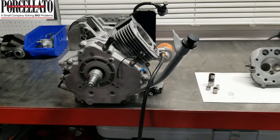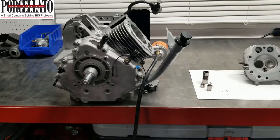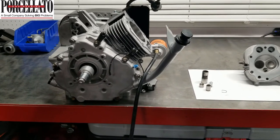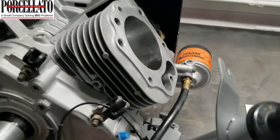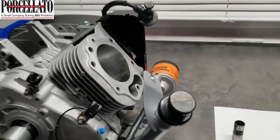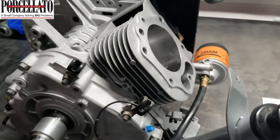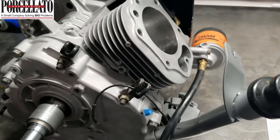This is that counterclockwise FE 350 that I had for sale. It sold right away — it just took a little time to get the parts together. Built the engine, went for a test fire the other night. Obviously we look at oil pressure, etc., and it was stellar. Just the valve train made a little bit of noise till the hydraulic lifters came in, and boom, the thing quietened down.